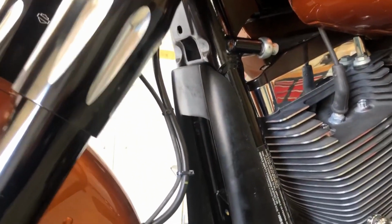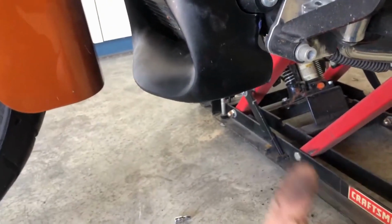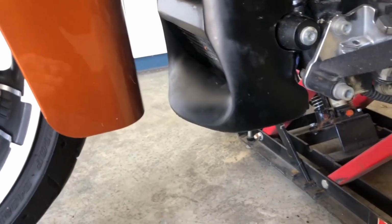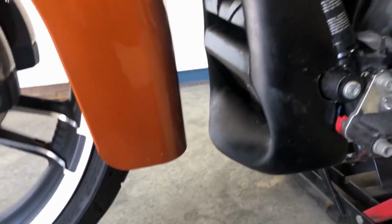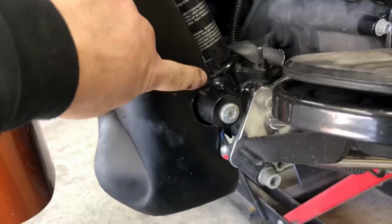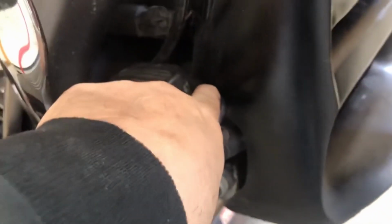Again, got my Killer Customs chin spoiler mounted up. I really didn't do anything to it yet. You need three hands to hold things when you're doing it. The way it mounts up underneath, there are wires and things in the way. I did have to oblong the hole just a little bit. The tab isn't quite sitting in the right spot, so this would let the bolt go in straight. Up here, everything's bolted up pretty good. I'm going to do a little trim right here. It's really tight against this weld, so I'm going to trim it there, and I'm going to trim it right here.